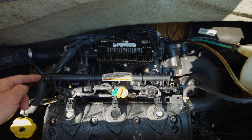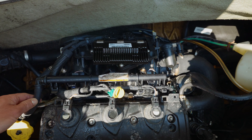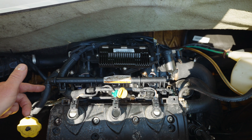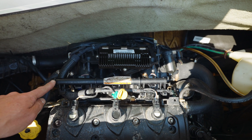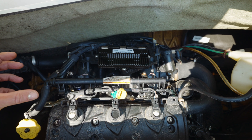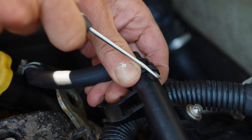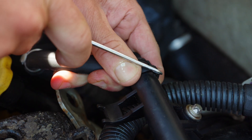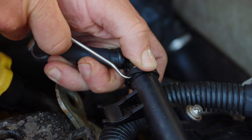This fitting — you don't technically need any tools, although it's hard to get off without a little clip. If your ski is running rough and you just want to quickly tell if it's bad gas, you can pop this off right here and spray it into a container. Pinch both sides and then try to get that tooth to pop off with the pick. There's a tooth on the bottom and one on the top.